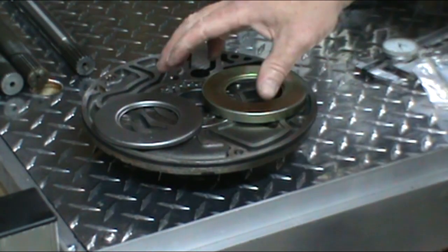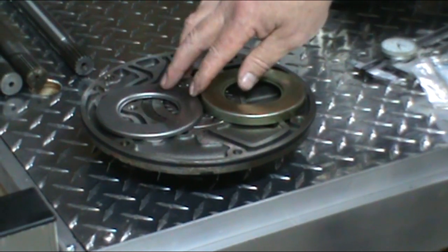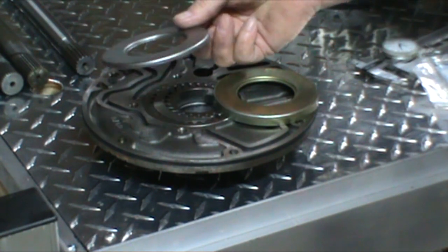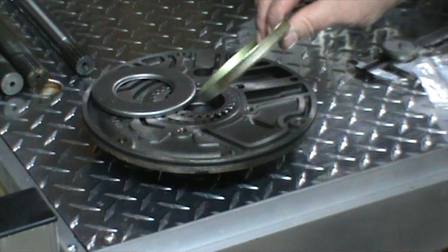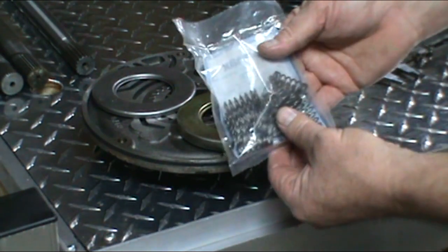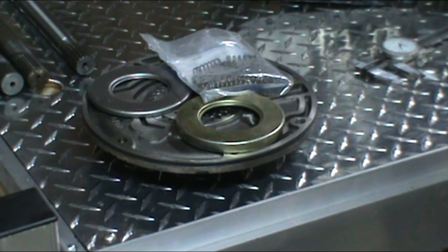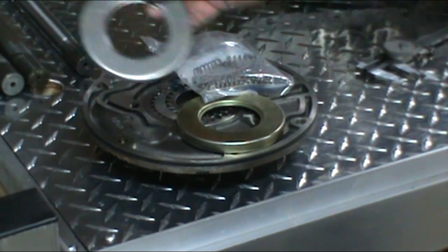Okay, another update we're going to do. As you can see the differences here — this is a rear piston spring retainer. The stock one is very thin and very weak. We purchased an aftermarket one that's much stronger — you can see it's much thicker. We also purchased new springs which are much stiffer for the trans brake. I would suggest you do this to every trans brake application you build. These stock ones are very, very weak and they'll bend.